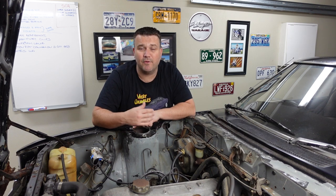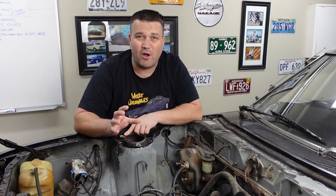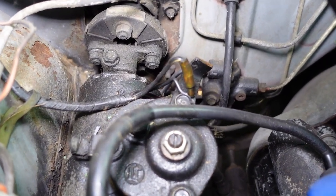If you can cast your mind back a few episodes ago when I rebuilt the brake master cylinder — that was actually because there was a problem with the seals in that cylinder. When you're applying the brakes, it was overflowing the fluid reservoir, and it obviously wasn't applying the brakes, which sucked. But it also spilled brake fluid out of the reservoirs down the strut towers and onto the chassis rails. That had obviously been happening for quite some time. All of the paint has reacted and basically peeled away, leaving a lot of surface rust on the strut tower. Not only that, there's also a lap joint at the very bottom of the strut tower, right near the chassis rail, that without being protected by that paint is basically just a magnet for dirt and water and has rusted out. So now we've got a situation where there's a large section that needs to be cut out and replaced with fresh sheet metal. What I'm going to do today is pull the steering box because that's right where I need to get access. I'll move the lines out of the way and then we can check back in and see where we're at.